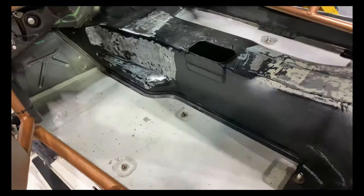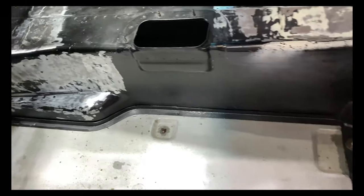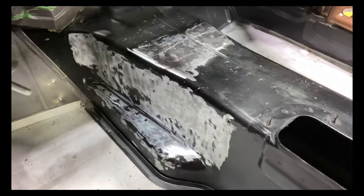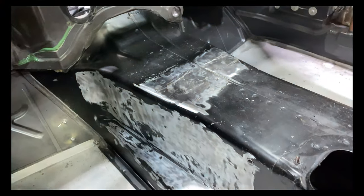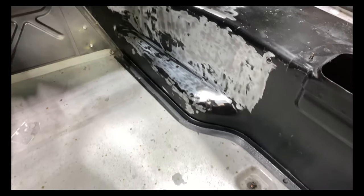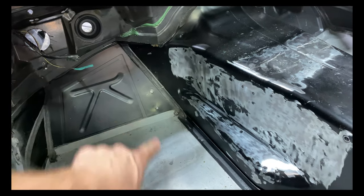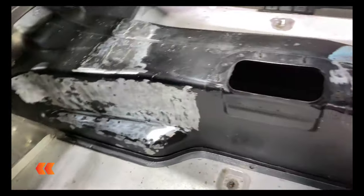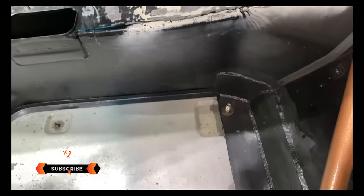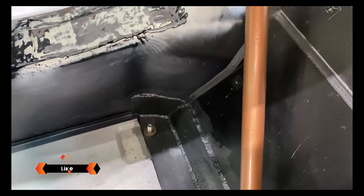You can see that I finally got everything cleaned up and cleaned out. I had to weld those holes shut that I had cut, so I had to weld those up. It's not perfect, but at least the holes are covered up, and I cut off some studs that I didn't need up in the firewall area. So that's all ready to go. I just need to get everything cleaned out, one last vacuum, do some surface prep, and get the areas that I don't need taped off. And then I'll get to painting.